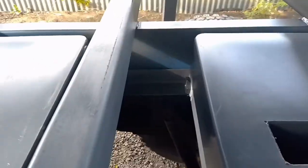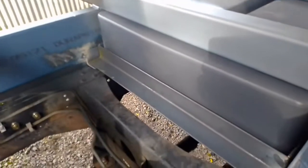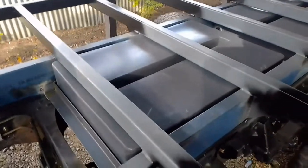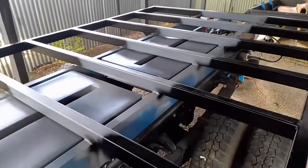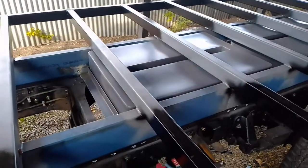As you can see, part of the cage there — I've added a cross member in here for some more bolt points, and again at the front it's all just tacked in at the moment to prove that it works and square it all up. So if I ever need to remove the tanks, they'll slide out as one cartridge unit at the back of the subframe — nice and serviceable.